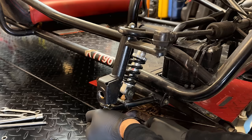So hopefully this switch has six terminals on it. And yes, it does. So I think we can use this. This is a pretty standard switch I see in most generators. The way it works is that you have three terminals on each side. The middle one is what you want switched, meaning, say we want to kill spark, we'd put a ground wire in the middle, and then depending upon the position of the switch determines where the connection's made. So if I flip the switch to the right, it should connect these two terminals. In this case, that's off, so that would kill the engine if I had a ground wire there.